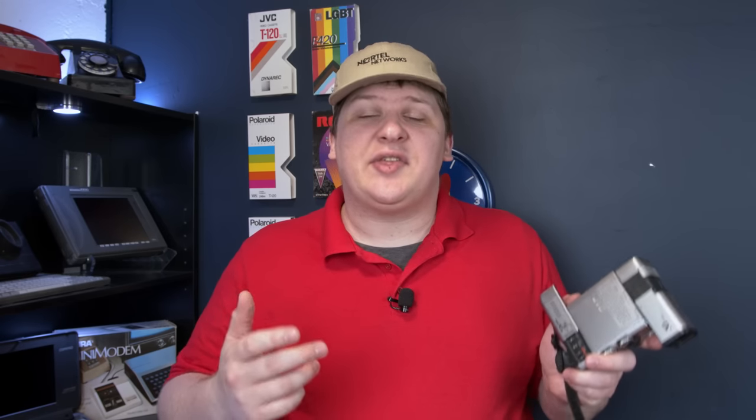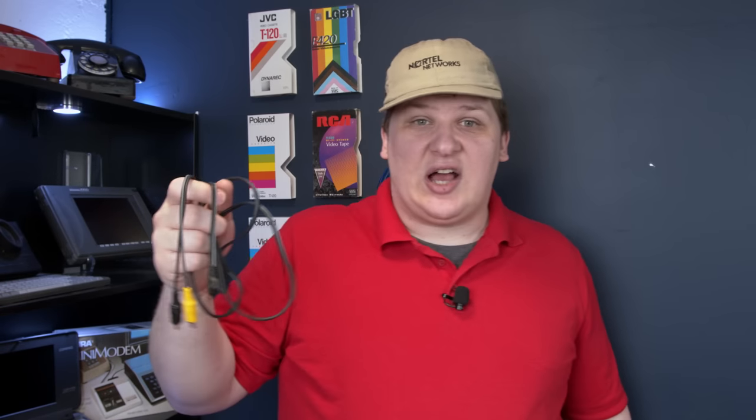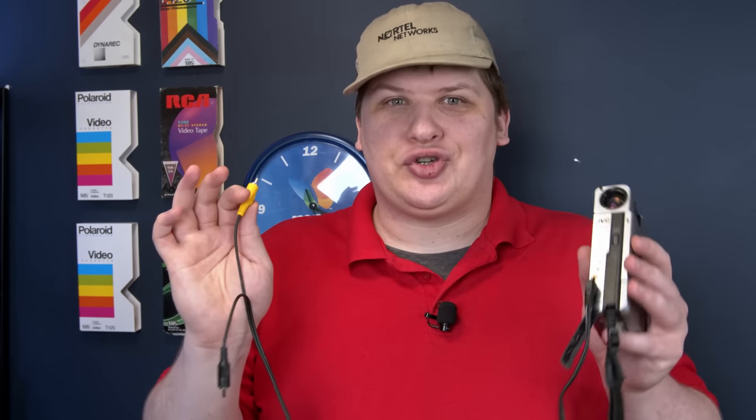If you did want to watch your video on a TV, that was possible. But almost nobody ever bought a VCR that played something other than VHS tape, which meant if you were going to play Video 8, Hi8, or MiniDV, you were going to have to plug your camcorder into your TV to do it. This here is your AV jack. For about 15 years, this is what everything used for AV — a 3.5mm headphone plug that adapts out to 3 RCAs. MiniDV was supposed to bring higher quality video to the masses, and this camera almost certainly shoots fantastic video, but this is the only way you can get it out? Viewing DV over composite was throwing away a lot of picture quality.